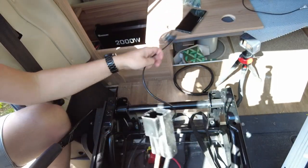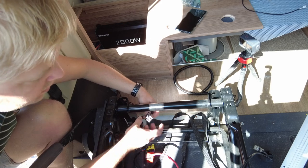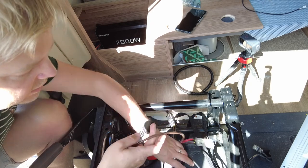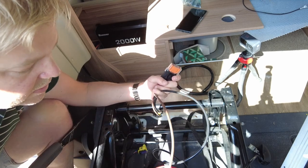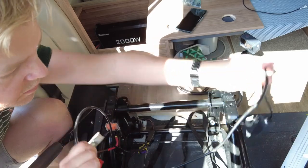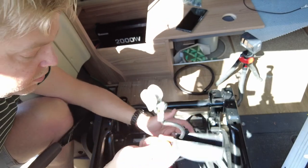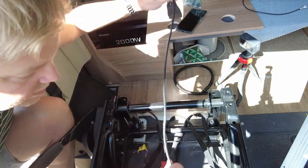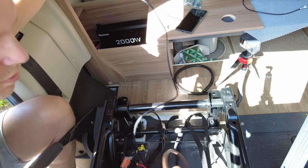This is looking good because there's a lot of cable length here. The cable that comes from the Sargent has got a terminating port on it, and the other end has got one too — so they connect together and then go via a 40 amp fuse into the leisure battery. What I want to do is run the negative or the positive back to the second battery. Now that I've taken all the tape off, this looks like there's good length on it.